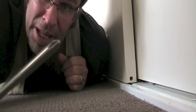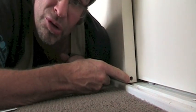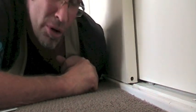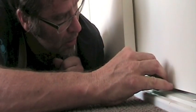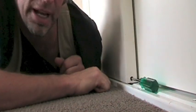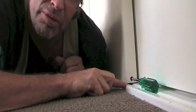That's your Phillips head screwdriver there. Locating the hole at the back of the door which houses your adjusting screw. Now, using the principle of righty-tighty, which is clockwise, we put the screwdriver inside that hole, locate the screw, and now turning clockwise you'll raise that wheel.